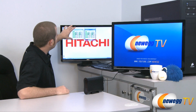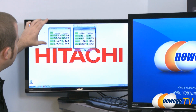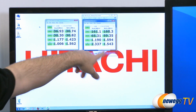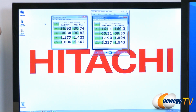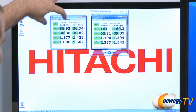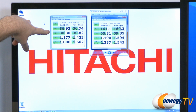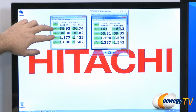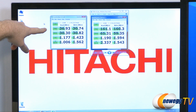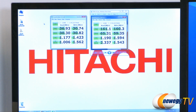So if you look up here on the left side, you can see the XL3000 that we have plugged in. Those are the numbers I just ran. On the right side are the numbers from earlier today from the internal Desk Star. And you can see a really huge gap here at the top in the sequential reads and writes as well as the 512K reads and writes. And you can see that the external drive is capping at about 30 to 36 megabytes per second, whereas the internal drive can really max out the performance.